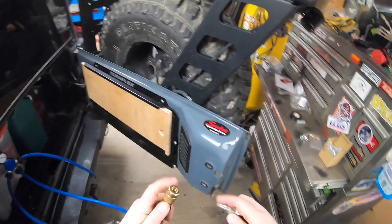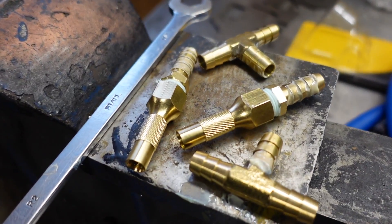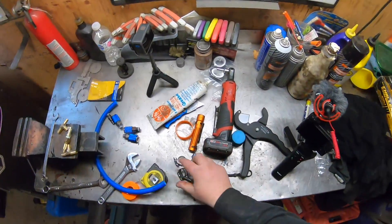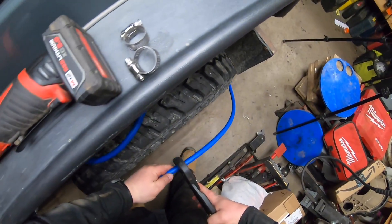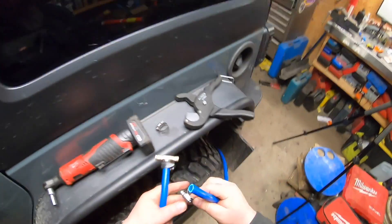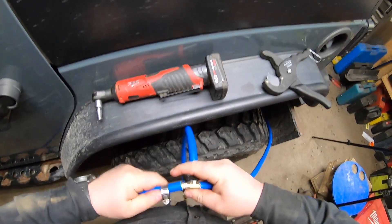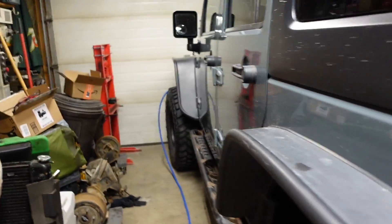I got a quick connect so I can hook it up to another air compressor or hook up tools. I got my T's and my valve stem adapters, two chunks of hose that are 20 inches each. I'm just gonna start getting these all put together - take the hose, connect it up. That side's done, ball valve is shut, that side's done.